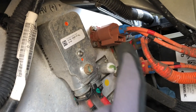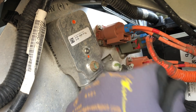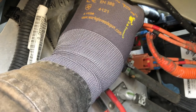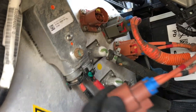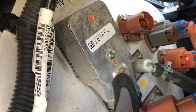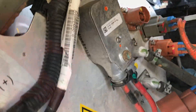I pulled out the red clip with a little screwdriver and pried it out. You can then push up on the center part of the clip and pull this connection off to the cabin heater. Next up, I'm going to loosen up this nut here and take the cap off to access the wires for the high voltage.